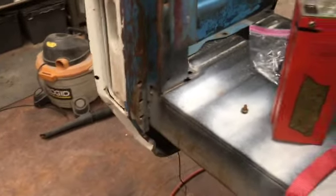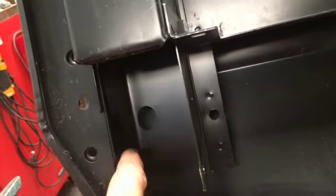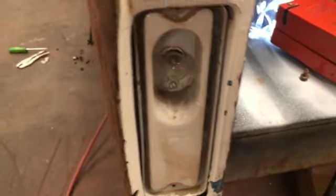All right, well, that's why it's good to have the new panel laying around, because if you study it hard enough, you find some secret hardware spots, and this is the holes for the bolts that I just removed on the forward side, and there's two more back here. Blind as well. Yep, these definitely have nuts. Let's see. Welded in. Let me give you a little light. Yeah, nuts welded in there. I still have the tail light assembly. Yeah, it's still stuck in there. So I'm sure the nuts are on the back side of this one as well. So let's get those out now.